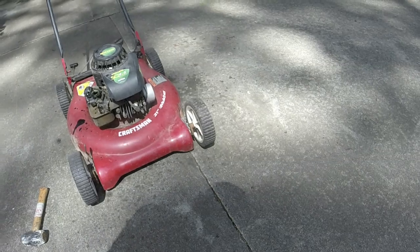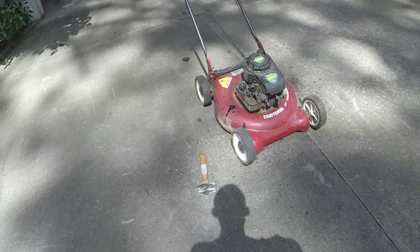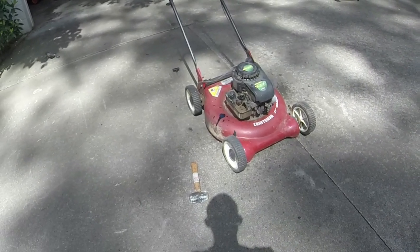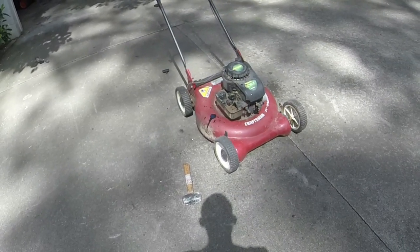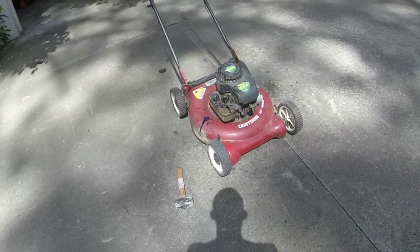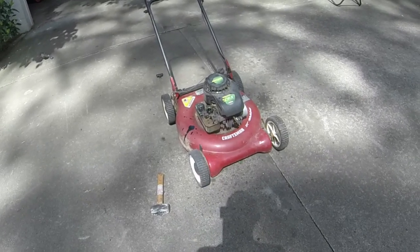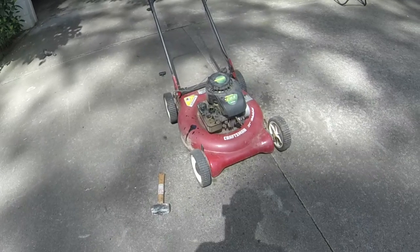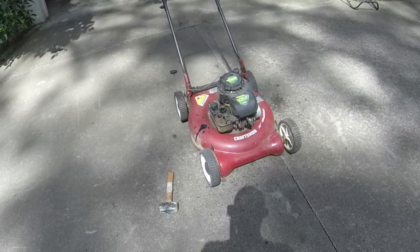That is a little bit better, and that's totally doable. Again, it was running way too fast as well, so that didn't help matters. So that's good. It obviously needs oil. Look how dark the oil is there. So I'm going to go ahead and do all the maintenance items and stuff on it. Blade's already sharp enough. I'm going to get the oil changed and clean out the air filter and just clean it up in general. And I'll give you all a final look before I sell it off.